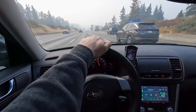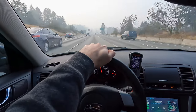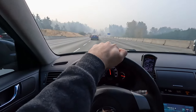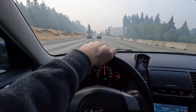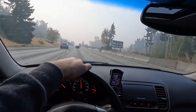We are so back! This thing feels excellent. Still got that slight rubbing noise up front — I'm starting to think it may just be the tire hitting the fender liner, so I need to look into that. The wheel needs to be straightened out just slightly, but the car drives completely straight, which I'd expect after a fresh alignment. Let me drop down and give you a fourth gear pull.